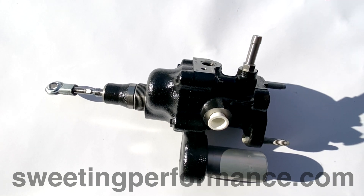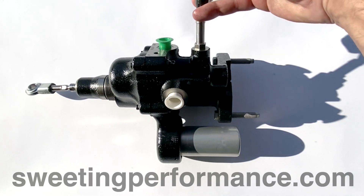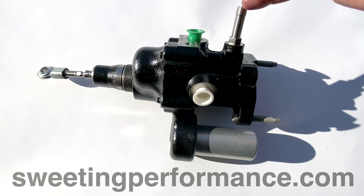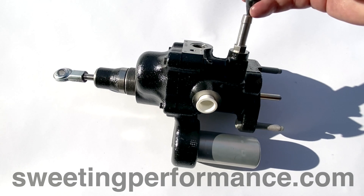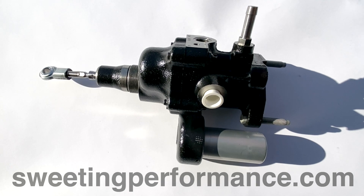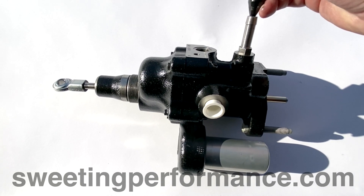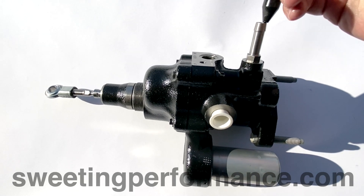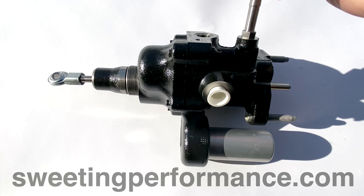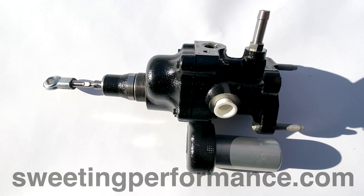If you install the T so that it points straight from the steering unit to the HydroBoost return, you will be the guy who is not leaving his driveway to go for a test drive. If you point the T from the HydroBoost return to the pump reservoir and put the steering unit return on the 90 degree branch, then half of all that fluid coming from the steering unit will split towards the reservoir and half towards the booster. You will be getting halfway down the road before your brakes lock up as it builds pressure.